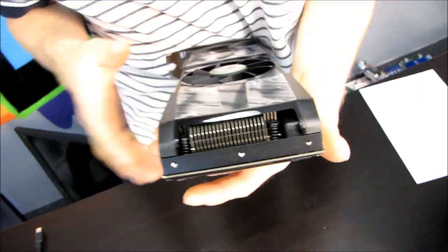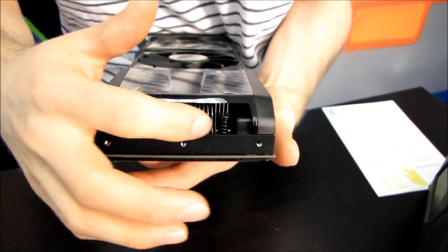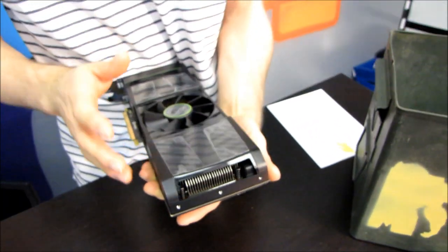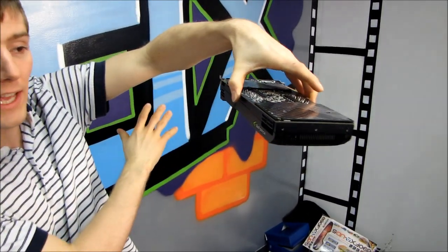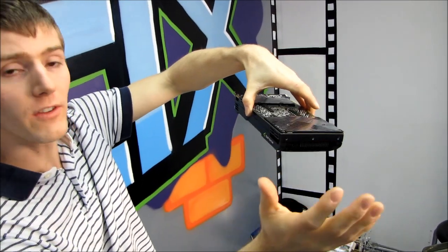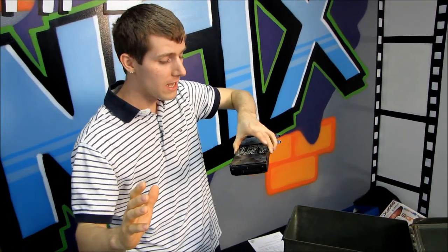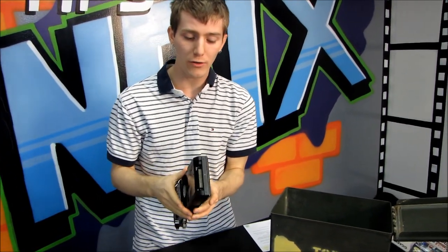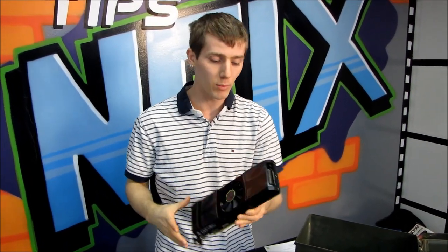The back of the card is a much lower restriction area. About half of the airflow from this center fan goes to cool one GPU and the other half cools the other, with air blown out the back. For quad SLI with GTX 590s, you'll need to think about airflow carefully — the bottom GPU could be blowing toward your front intake fans, so you might want to change those fans to exhaust instead, so you're not fighting the direction the card is pushing heat.